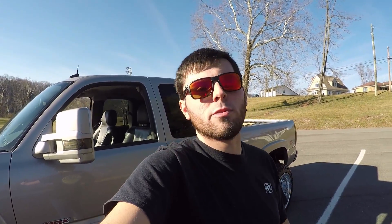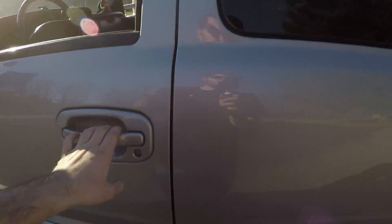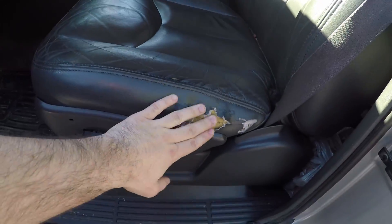For example, the rock lights I currently have — one of the lights went out, so we need to replace the rock light kit, and I'll do a video on installing that. If you own this generation truck, you know that the driver's seat has that rip — it's the only problem with my interior. I have a brand new bottom seat cover and that panel piece already delivered; I just need to find the time to put that on. The oil pressure sensor is a big one — my oil pressure's pegged to 60 even though it's not actually 60 PSI, so I need to replace that sensor. Definitely stay tuned, hit that subscribe button if you're not already — a lot of cool content coming, including once we get to the truck show.